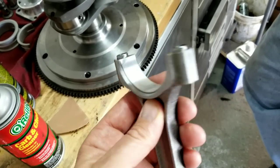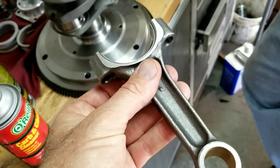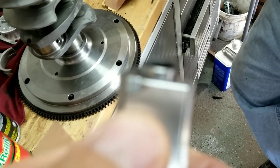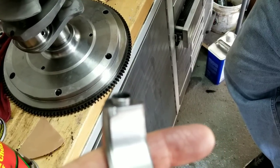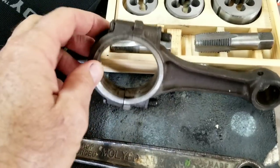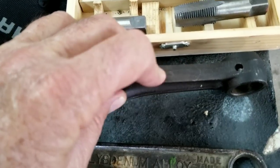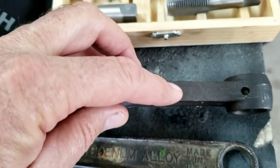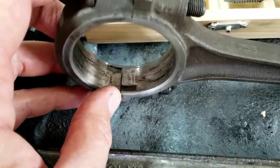Once you get past the rod fitting it's usually pretty easy, but you really want the bottom end to move freely. If you tighten the rods and things don't move, you've got to take them apart and look for those tight spots. If you can see a little crushed-looking spot, that's what you need to work on. Let me show you the stock rod — in the books they show you to put this part up on your rod.